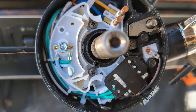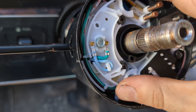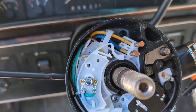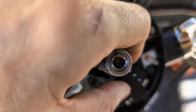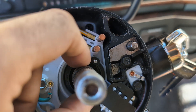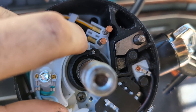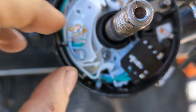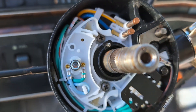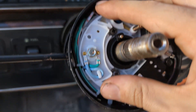If you've got a mid to late 80s or early 90s Ford, this is how it works. Here's your turn signal lever, and when you hit a turn it does that. Meanwhile, this part here is captive to the wheel, and when you start bringing that wheel back around — providing this arm is lined up appropriately — it pushes you back to a neutral position. And that's how it works.